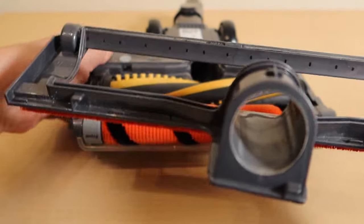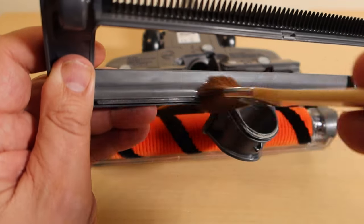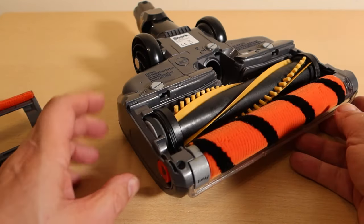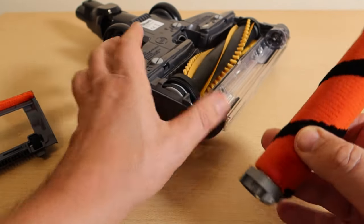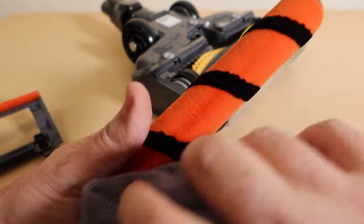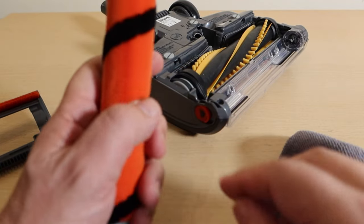The whole piece comes away. Back to your brush — make sure these teeth, which do the job of getting hairs off, and anywhere else you can see, get a good dusting with your soft paintbrush, checking for any damage. There's a second roller here that's very easy to remove — just pull it out. I use a lightly spritzed microfiber cloth on that one. Keep it clean; if it's really dusty, do that outside. It should be free-spinning — if not, it needs more cleaning.